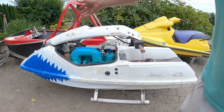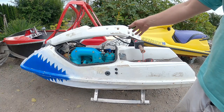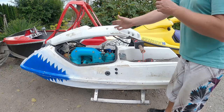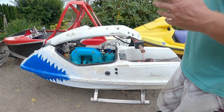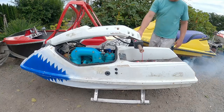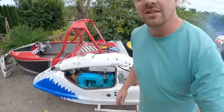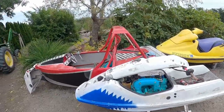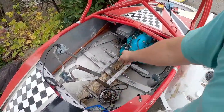I've put the Sea Rat e-box back inside the Sea Rat. I just need to fire it up and confirm that there's not something in the e-box getting blown by the electronics on the miniature jet boat. If this e-box fires up and works here, then I can confirm that whatever's wrong on the jet boat is in the front engine cover — the stator section, flywheel, something in there. And since it still runs, that e-box is good. I'd bet there's nothing wrong inside the e-box for the miniature jet boat — whatever our problem is, is inside that cover.